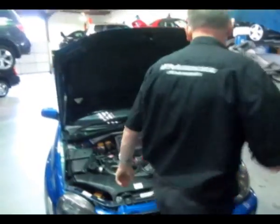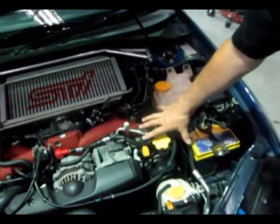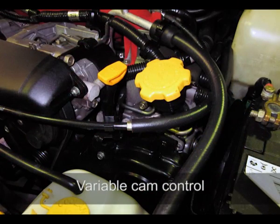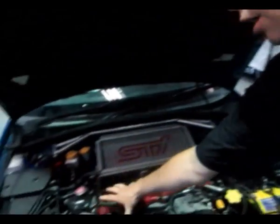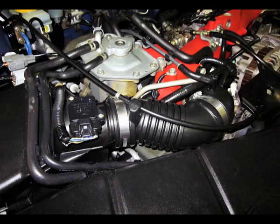What I want to show you — just getting my camera a minute — it's a bit hard to see on this side of the engine on the inlet side. I'll start showing a still photo. Around here you've got the variable cam control, which is actuated by a solenoid through the engine oil pressure, and of course on the other side — driver side if you're in Australia — there's a similar setup under there as well.